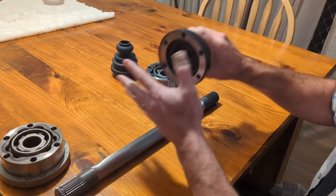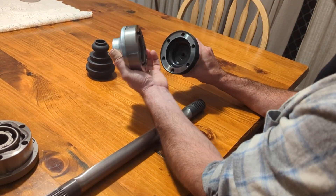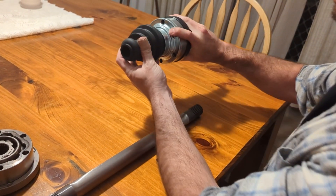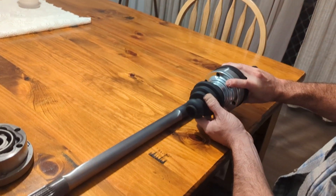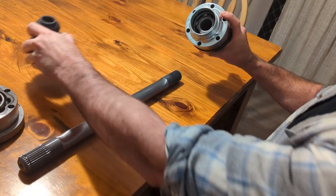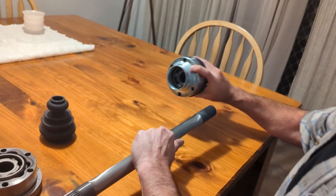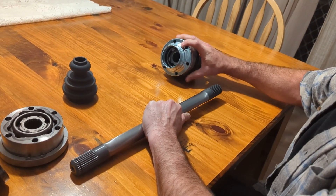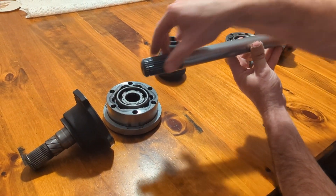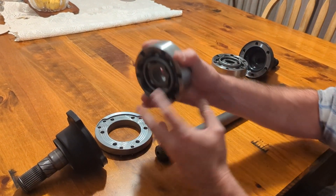The idea of all this: we go into the BMW wheel hub, we then bolt a CV joint onto that, which has a cup on it that the boot can go onto, which then goes onto the axle. That sorts out the outer side with a sealed, greased-up section. These splines are cut to go into these CV joints, and at the other end we've matched it up with the same type of CV joint, so we have a uniform diameter 28-spline at each end.